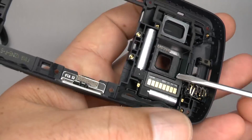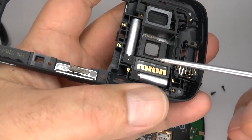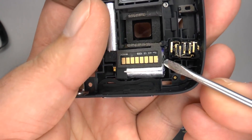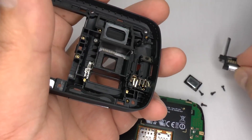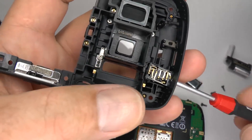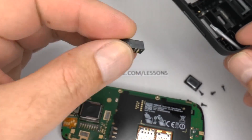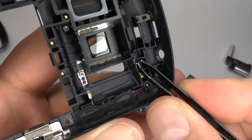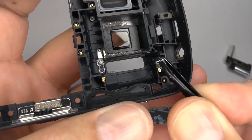If you're replacing the rear housing or the metal camera surround, we need to remove some components. Remove the Xenon camera flash by gently lifting up — that comes out nice and easy. Now remove the headphone jack by inserting a small screwdriver and lifting it out. Then use a pair of tweezers to lift away the small rubber grommet, which will expose a T5 screw.